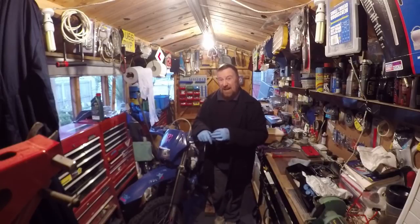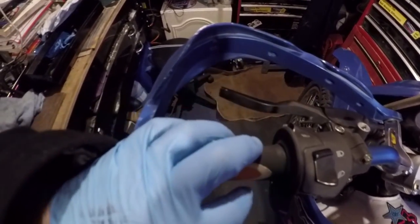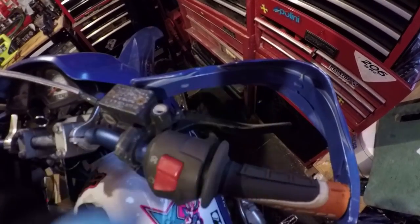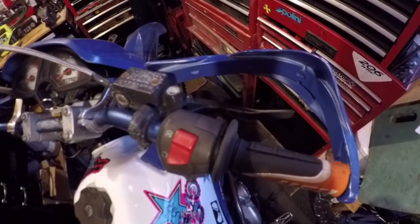Servicing otherwise is just a plug and air filter. Single carb on here, no kick start. This one's got a sports exhaust and it doesn't sound too bad. It won't start because the battery is dead, so that's something we've got to sort. He's cut the levers — I guess to get them in here, they may have been too long. For the MOT they will moan about these being cut off. It shouldn't fail but they'll definitely moan about it depending on where you go.